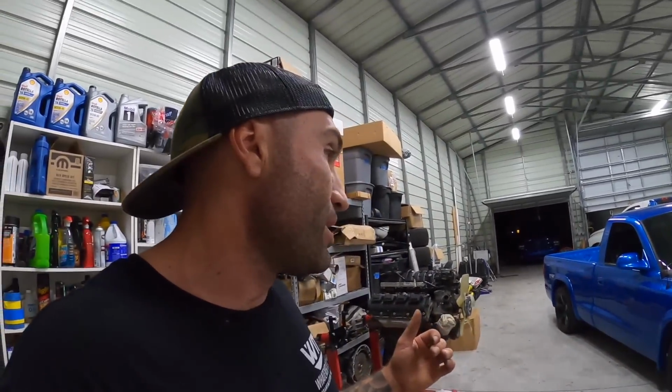So that was the other day. Thankfully, everything's good. Once we disconnected the PCV system, the screaming went away. So what's probably gonna have to happen is I'm gonna have to get a different valve cover for the driver's side so that I can have the fill neck, because there does seem to be some differences between the valve covers. One of them has a check valve, one of them doesn't. And when I swap the two, you get that crazy screaming noise. So that's the situation there.